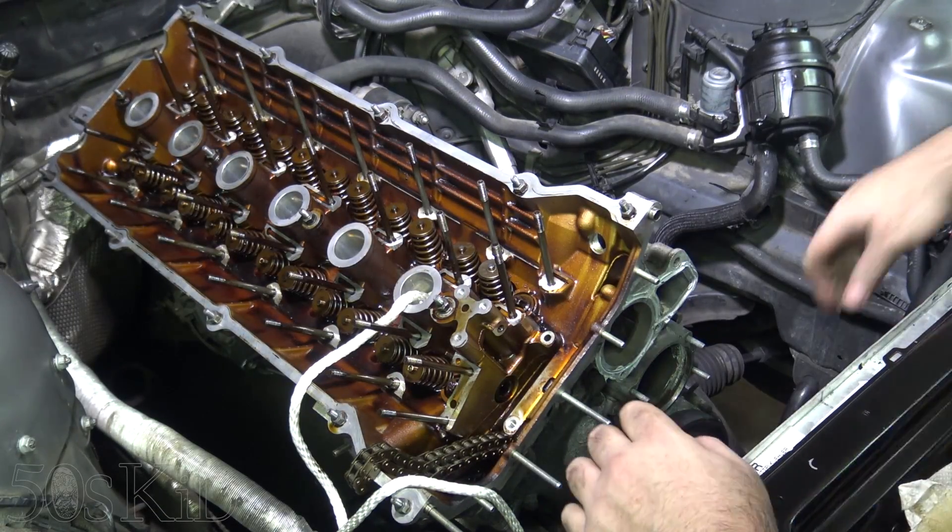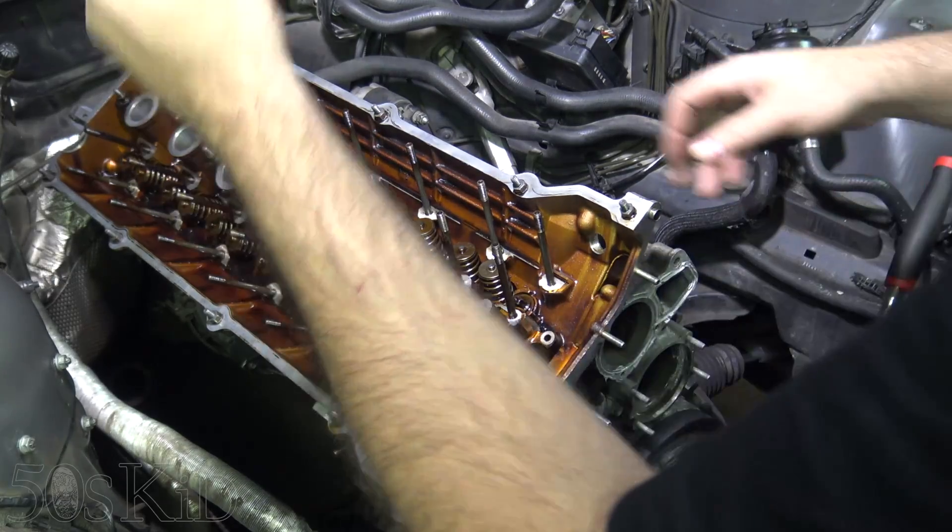We can pull this piece of paper out, back the piston down, and get the rope out of there. It's definitely possible to do this in the car — I think you definitely need to make the tool I made. The most difficult part is probably cylinder number six because it's so far in the back. The car is jacked up right now and you'd want to lower it first to have room. I'm probably just going to use this tool I made to reinstall the valves once I've got the cylinder head off — I don't think I'll find a better tool for cheap. If you enjoyed this video, please like and subscribe. I'm the 50s Kid — thanks for watching.